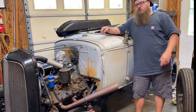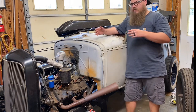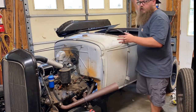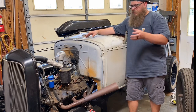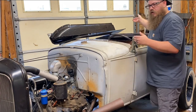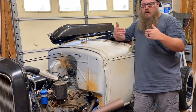Make sure the alternator goes straight to the battery — some guys run straight to the starter solenoid. For the starter side, battery goes directly to the starter solenoid. I use single aught wire, which is pretty big. Most of the time my batteries are in the trunk far away from the motor because I still run the original gas tank. The gauge of wire is determined by length and amps — for a starter with the battery in the trunk I like single aught to double aught, with one gauge if it's a bit shorter. Single aught is my sweet spot.